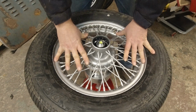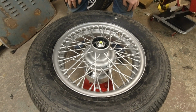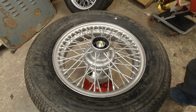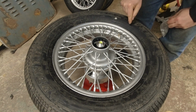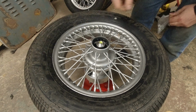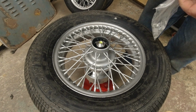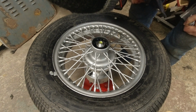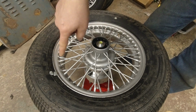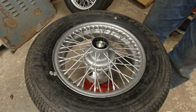Put the tire on, and you want to make sure that it goes down all the way so it centers on that cone. This one is not bad at all. I bought this set of weights off eBay. Let's see if we need to do anything. It looks like we need to add a little bit of weight on this side. So it doesn't need much because the bubble's very, very close. And I did two because I'm going to put one on the outside and one on the inside. And this one was super, super close.